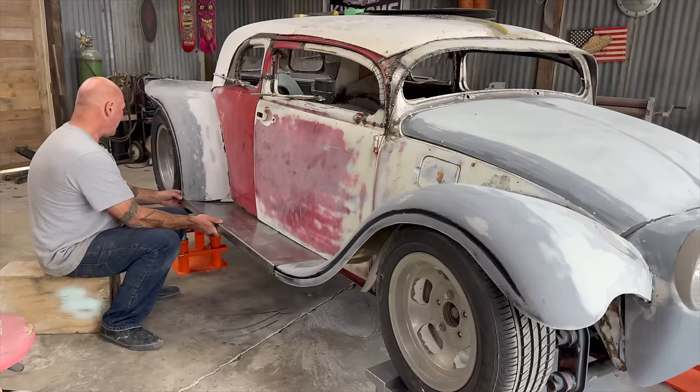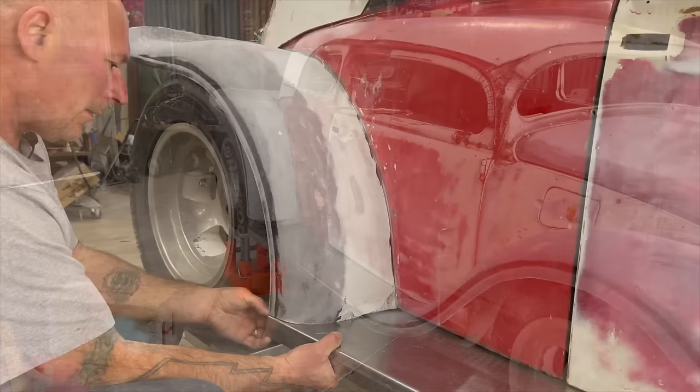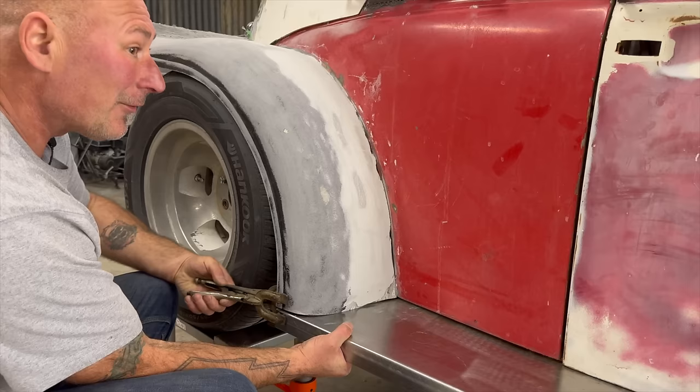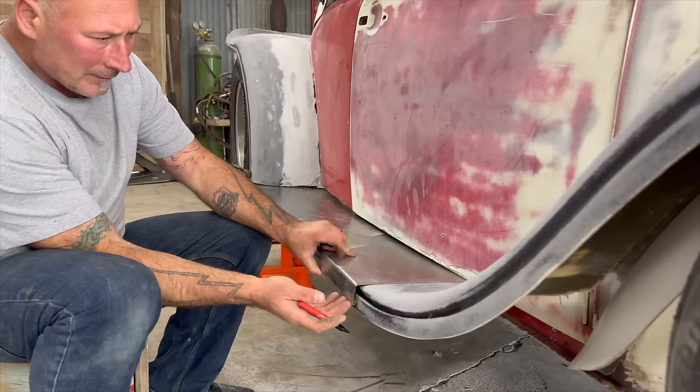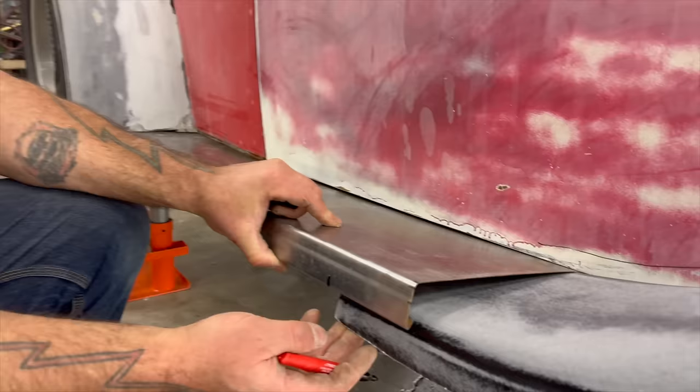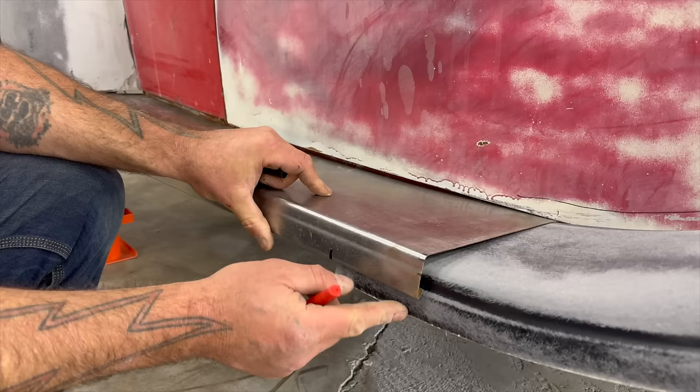I'm going to get a clamp and hold that up there — we're going to work on that join. Surface height is everything, so we're going to engage in discussion on the front fender join. We got this pretty big overlap of fiberglass and steel from approximately this point here because I'm looking at the fender underneath. I'm going to cut off this little lip, unless — maybe I can do what I did on the other one. I can slice up through here and let this go inside. Let's try that — that's going to be way stronger.